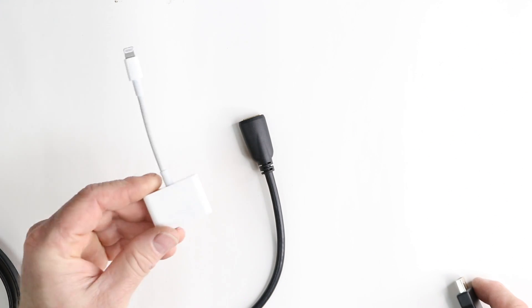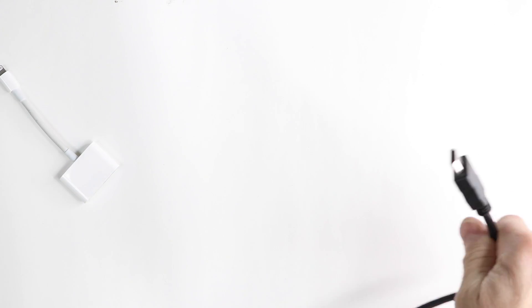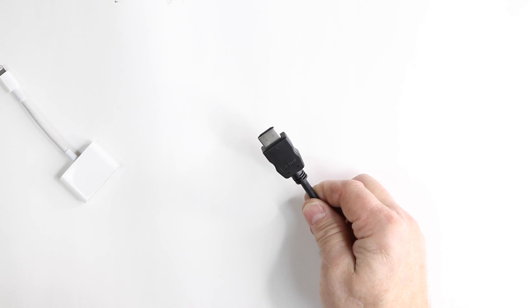For this, we're going to plug in the lightning adapter. We have our HDMI cable — plug that in. We have our HDMI in and our lightning adapter connected. On the back side of this, you'll notice the charge port for your phone. What you want to do is take the lightning adapter you have in your car — either hooked up to the Kenwood USB, a cigarette lighter, or whatever — and plug it in here. This is only for charge; it doesn't move data or anything like that. Nothing is pushed over this — just charge.